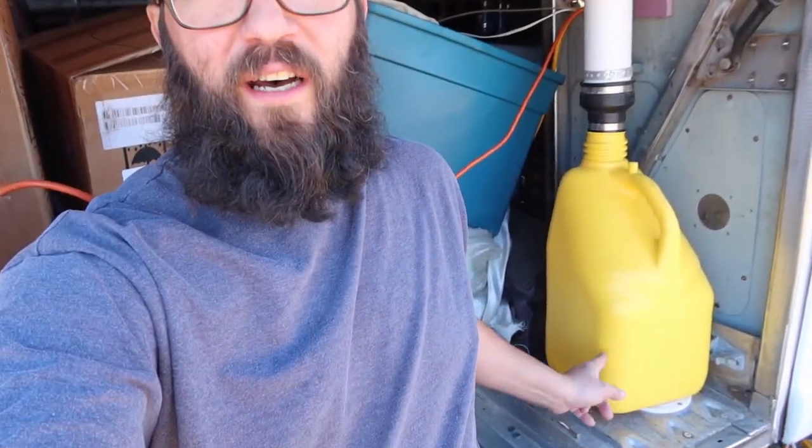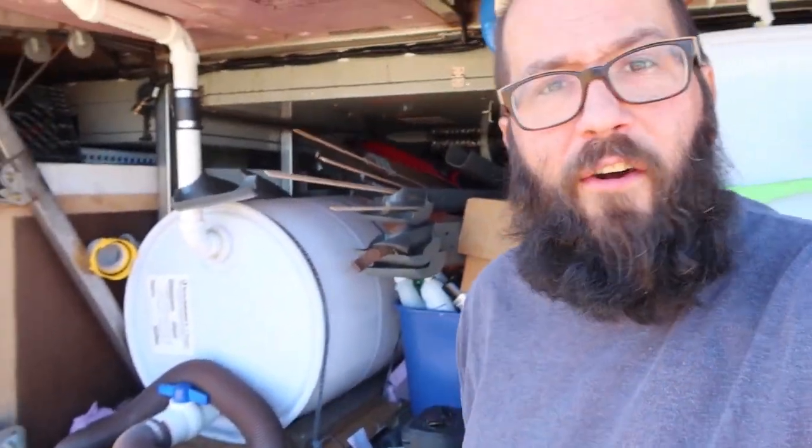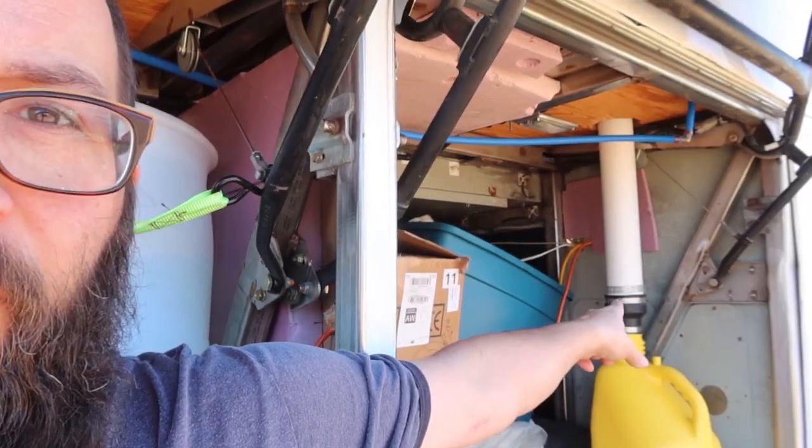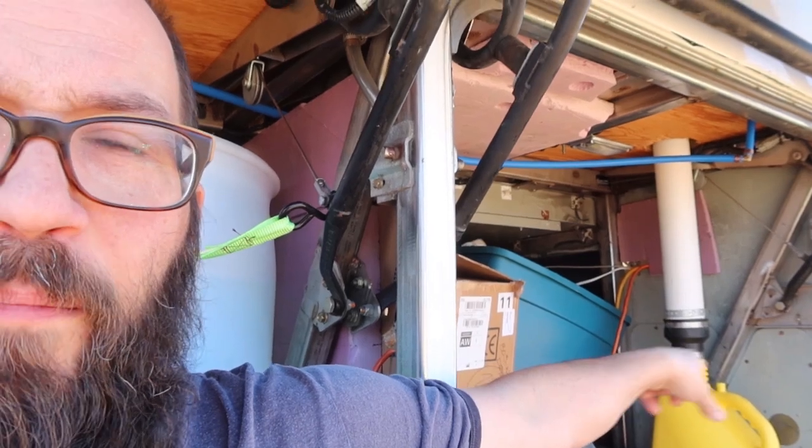First things first, maybe I've got to get the barrel and make something. My idea is something similar to this, but I bought a little bit different fittings. This is our graywater tank. Right now the graywater goes into this fitting here. This two-inch hole isn't going to work coming from the toilet, so I bought a grommet so that the three-inch pipe going down into there and being reduced down will be able to go right into the top of the barrel.